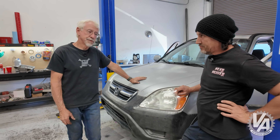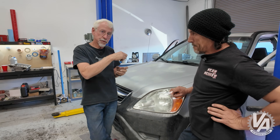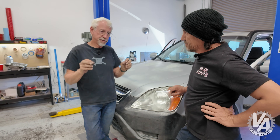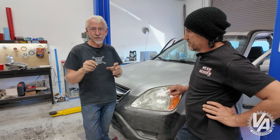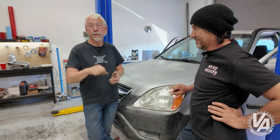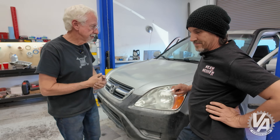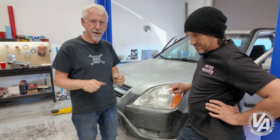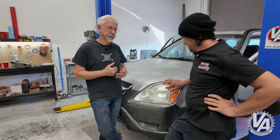We have our six-speed converted CRV, and it has essentially a TSX gearbox in there, but the shifter is out of an RSX Type S. There's a little solenoid that keeps you from hitting reverse when you're moving around fifth and sixth gear. When you're going for fifth gear you could accidentally jump it down into reverse — it makes a lot of noise, and it's unnerving to be driving on the street and have that happen, particularly when you're driving aggressively.